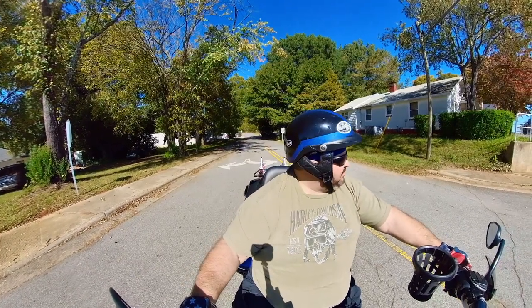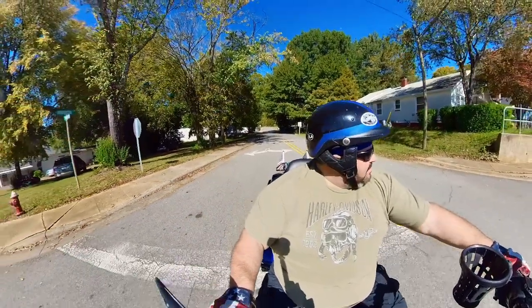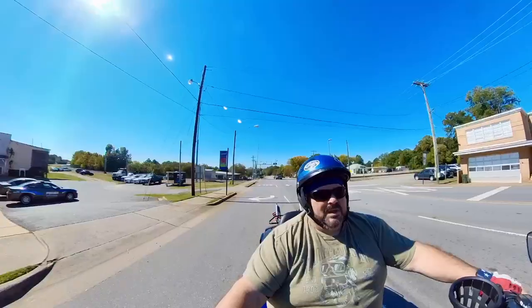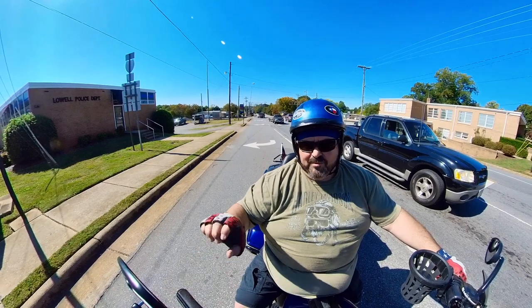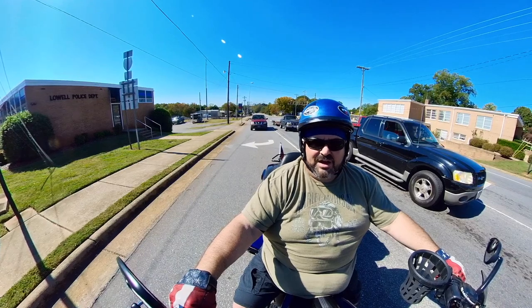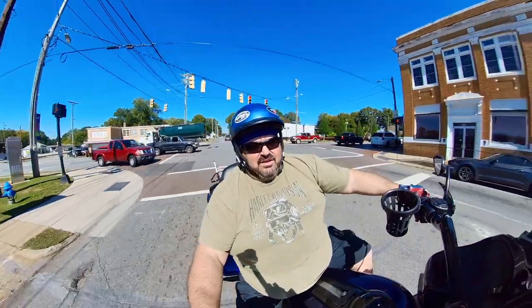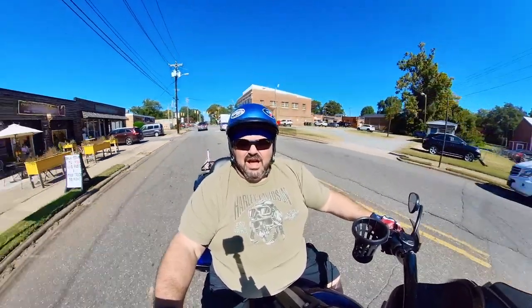Definitely a different feeling, guys. I mean, it's immediate. I guess the difference is I wasn't pulling the clutch all the way in before, so my hand was always out in an out position, which really tires you out when you're having a lot of clutch work. Right now, man, I'm almost all the way in. I am all the way in to the engagement, and then I'm just barely releasing it, and I'm already in the friction zone. So I think I'm going to like this a lot.